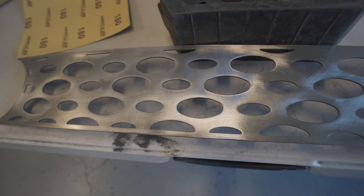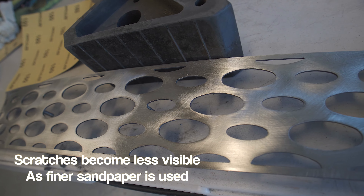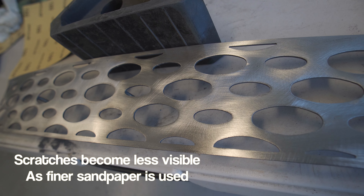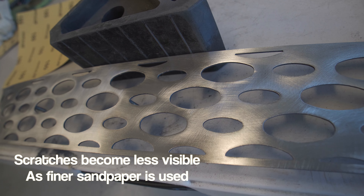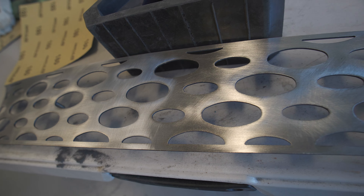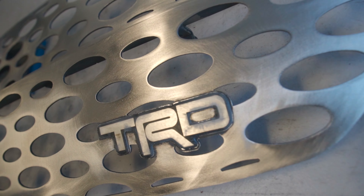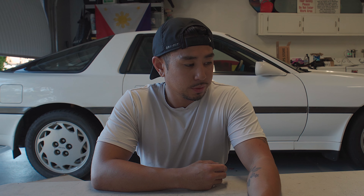Here's a quick look at exactly what we're trying to accomplish. On the left side is what we hit with the 180 grit, and that darker portion is what we hit with the 80. So you can see we're making a difference. The second stage of sanding doesn't take much time. We're just going to keep at it until we get a smoother finish and progressively move up in grit until we get it even smoother before we lay down our primer. So we got through our three stages of sanding, wiped down the surface, and now it's all clean and ready to start building up to painting.